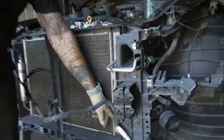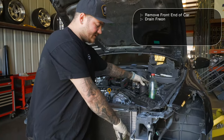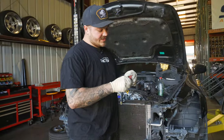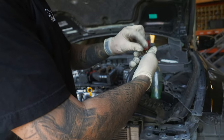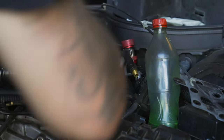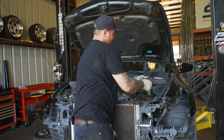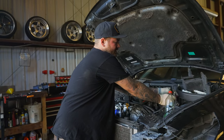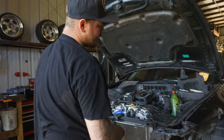If you are taking the front end apart and taking the condenser off, there are two 10mm bolts right here that make it convenient to pop these lines off, but you don't want to do that until you drain your freon — if you take these off it's going to blow freon at like 10 million PSI, basically a big explosion. They have an AC drain tool that clips right on here. Make sure it's closed beforehand — there are arrows for closed and open. We drain ours into a bucket and then have a recycling thing we dump the freon into. Try not to just let this go in the air; this stuff's really bad to breathe. Get it started and walk away and let it do its thing.